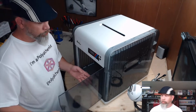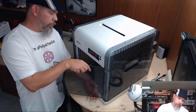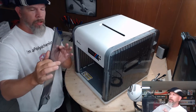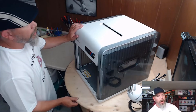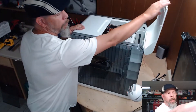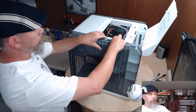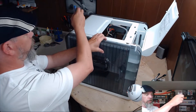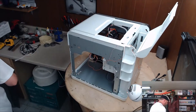First thing, let's take the door off. Press just a little bit right here in the middle, bend it a little bit, the bottom will usually pop right loose, swing out, and the door's off. Take the side panels off next. We'll lift the top cover — grab a flathead screwdriver, pop this as far as it can go, pop this, lean it out, pull it past, and it's off.